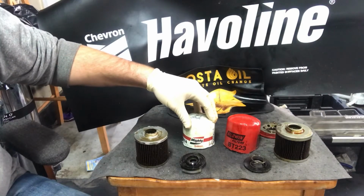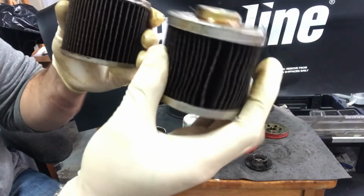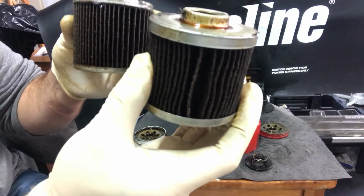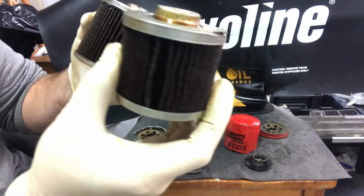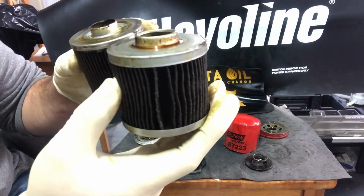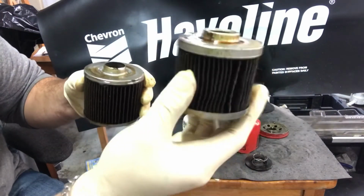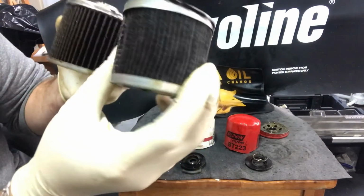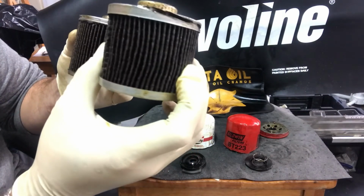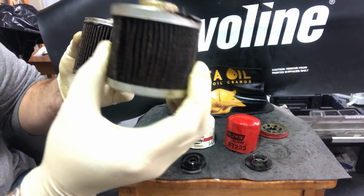They're both very similar and different in a few different ways. The actual filters themselves are in metal housing, and the bypass valve and the base plate, and the entire construction of the filter portion itself are both done in a manner that is consistent with a mid to high level filter. This is the Baldwin, this is the Mighty filter. As you can see, there's not a huge difference between the two of them. These both look like full synthetic medias, but it's really tough to tell.